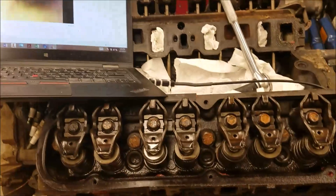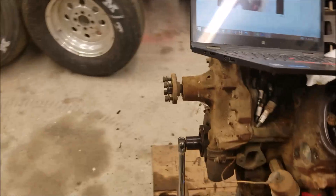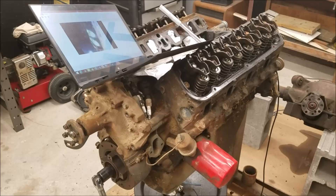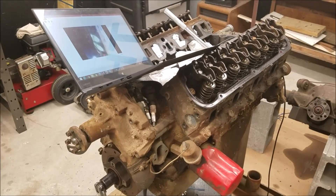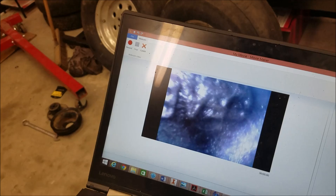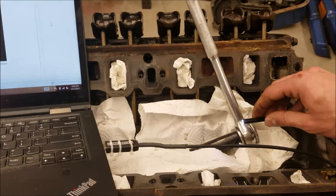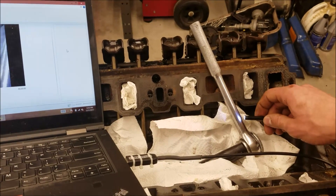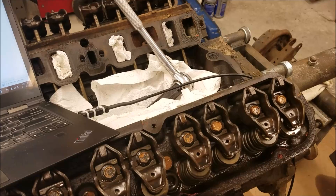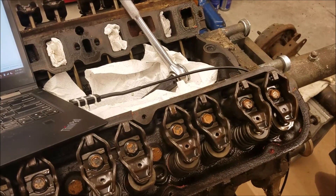Overall, as a spare engine it's all right. It's going to be the rot stang backup engine — we'll pull it apart and do a quick overhaul. The heads are E6 heads: it reads 'E6AE,' which is consistent with truck heads. They're not really good for any performance stuff. E7 heads aren't a whole lot better, but they don't have the valve shrouding that these E6s do. These are just made for real low-end torque below 4000 RPM — pretty much all done after that. I had them in a stock engine in my F100 before the 289 went in.